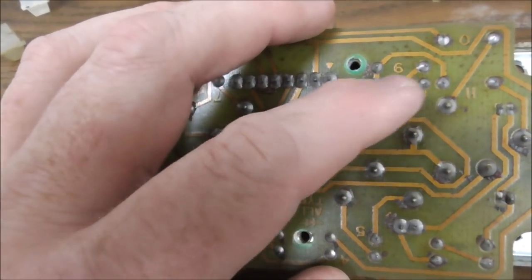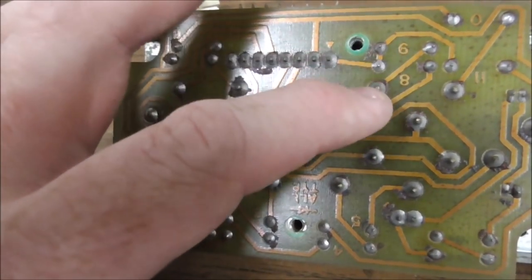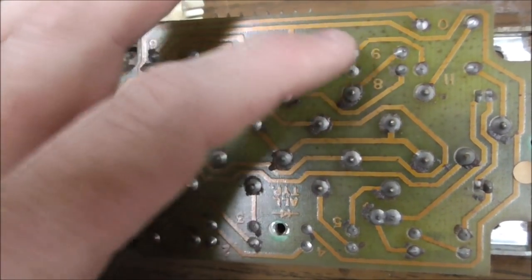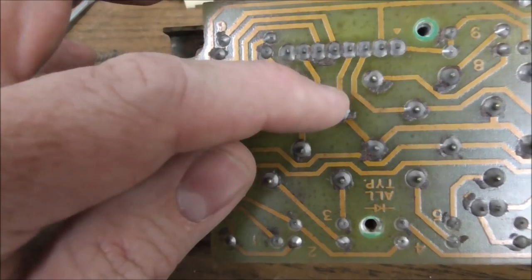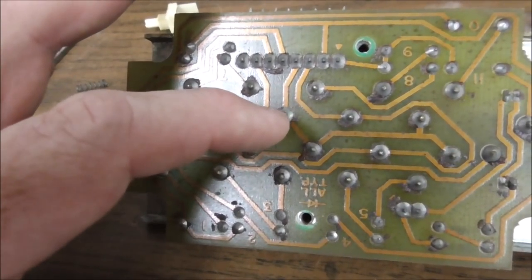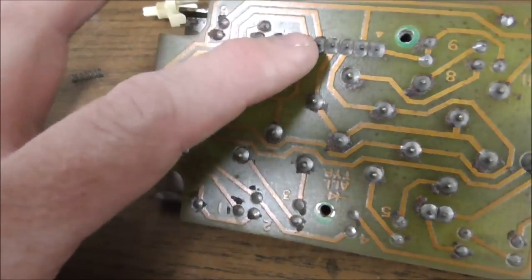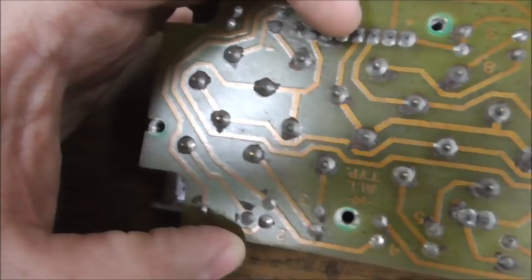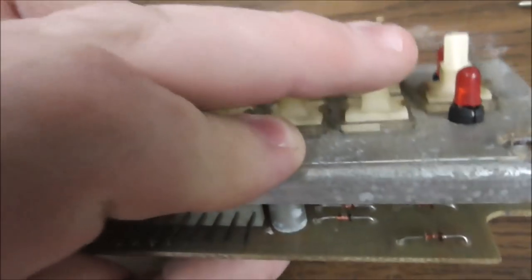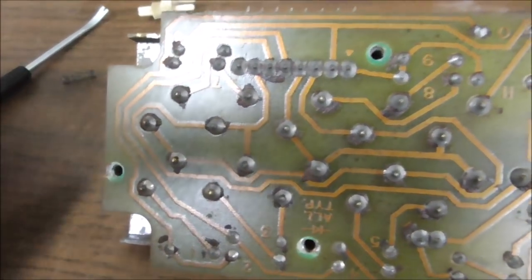So I'm going to check all these diodes too, especially number 8. Since they all work, well, 8 worked too, it just didn't work very good. You know, you could have a bad diode if you have one that's not doing anything. It could be the diode that has the number on it. But in general, they all use the same lines, you know what I mean? So if you only have one that's broke, it kind of has to be the actual button or the one diode associated with it. It's not really going to be the wire, because if this wire was bad, then not only would 7 not be working, but 0 wouldn't be working, and 0 was working fine. You see my point.